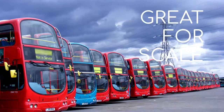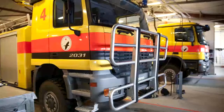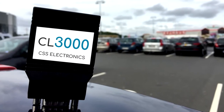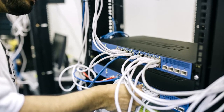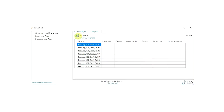Number 3 — Great for scale. Want to get data from across 50 trucks in a garage? Taking out CAN loggers one by one to transfer the data is simply not feasible. However, with the wireless push feature, you can auto-sync data to an FTP server when in range of a specific Wi-Fi hotspot. Further, you can use our free CANVAS software to load, DBC convert, and merge all the files for analysis — all in a few clicks.